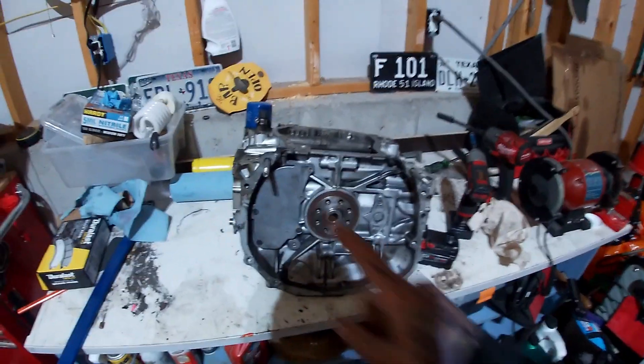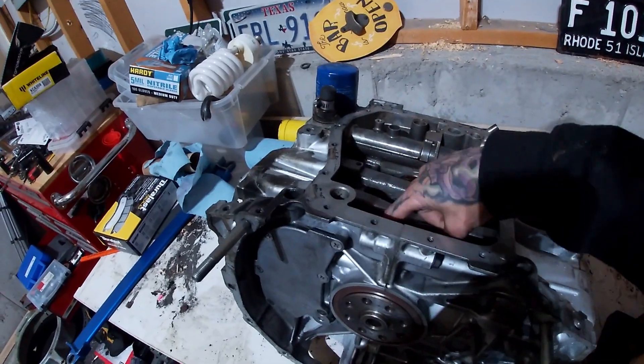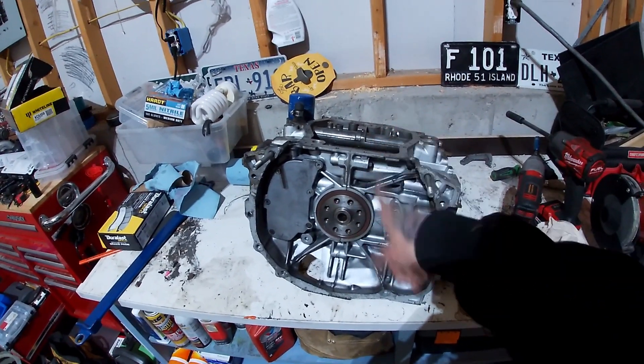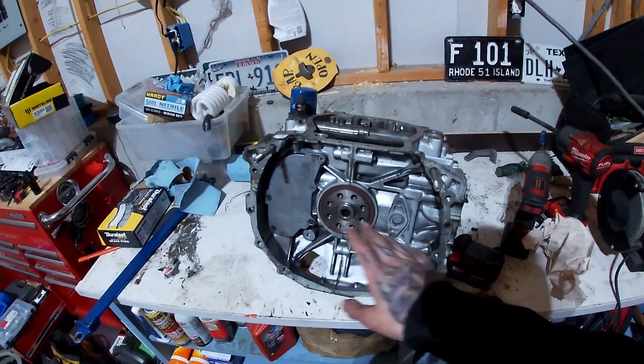Here's my build bench — this is the EJ25 or 255 out of my WRX. You guys saw the last video of me tearing it down and seeing what was wrong with this block, and it was a cylinder 4 rod knock. What we're going to be doing today is tearing apart this block, taking the pistons out, taking the rods out, taking the crank out, and basically getting it ready for reassembly. Tonight is just splitting the case halves and getting it all separated, and then maybe tomorrow I will show you guys me putting it back together with the new parts.